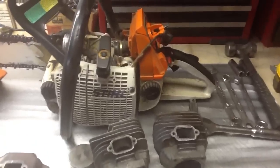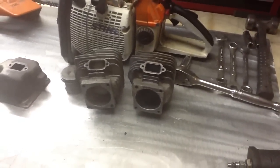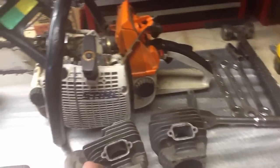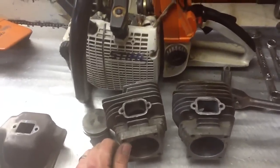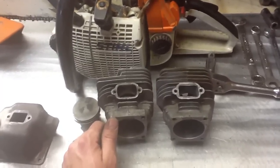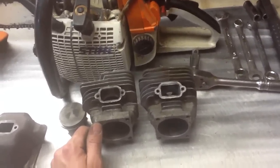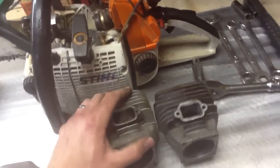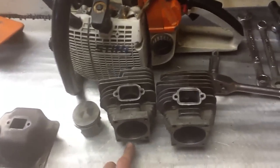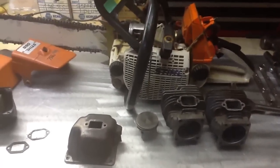Bolt that back on and check your compression. Don't get too carried away — too high compression and you're either going to be hitting the top of the cylinder or making too much compression, which is actually detrimental to the engine. I'd suggest sanding your decking and putting a thin gasket on to see where you're at. If you want to get more into deck height and squish, you can test that — Play-Doh works pretty good for that. Mock it up, pull it over, and see how much room you have between the bottom of the cylinder head and the top of the piston. I like to machine the decking a little bit and put on a good gasket. Some guys run with no gasket — I think it's better to run with a gasket, just my opinion. A lot of times you don't have access to that type of equipment, but doing it slow by hand can get you there.